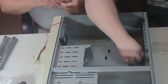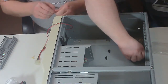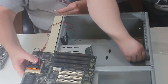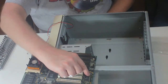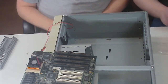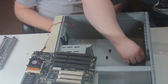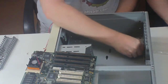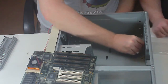Where do these screw in? Here? Okay, and yeah, here? There's 2 spots there on the back. And looking at the motherboard, you can see these 2 spots for the screws. And notice that there's silver all the way around, and that it's got lumps to it. That's so it makes better contact with the grounding screw. So it's critically important that we do this, especially since in this particular case, the rest of the standoffs are plastic. You've got electricity running through it, you want to ground it. Simple as that.